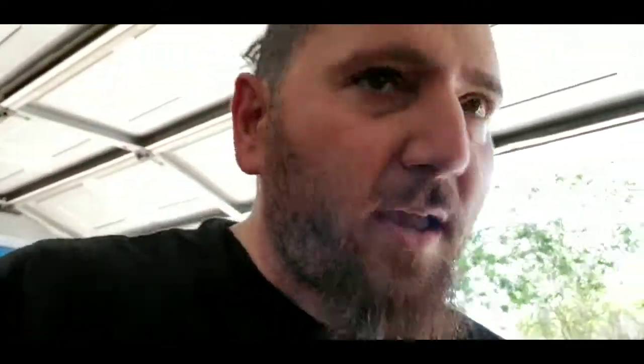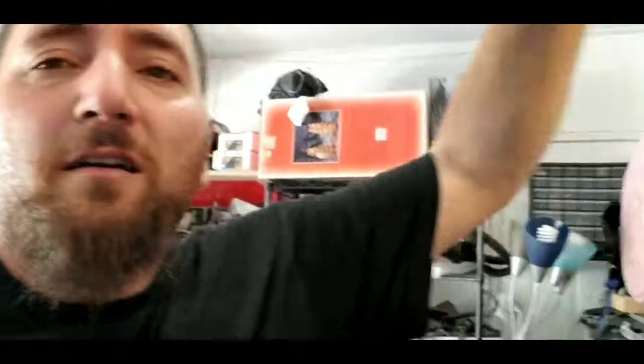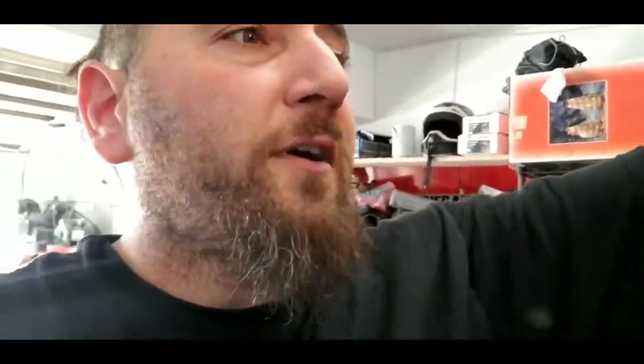This time I made the mistake and grabbed the wrong can of WD-40. Usually I spray it with normal WD-40, but I have a can of white lithium — and these cans look the same when you're in a rush — which ended up glazing the cylinder walls.